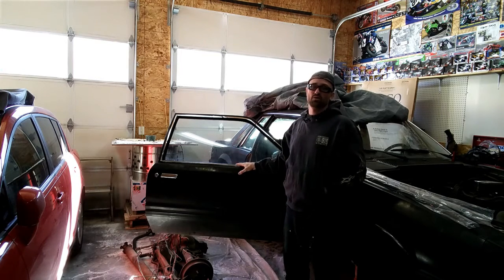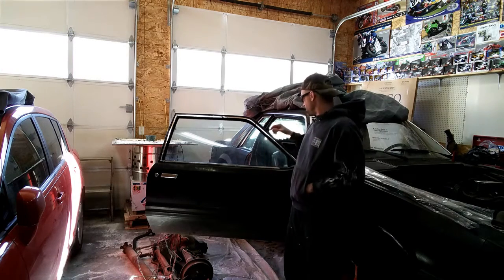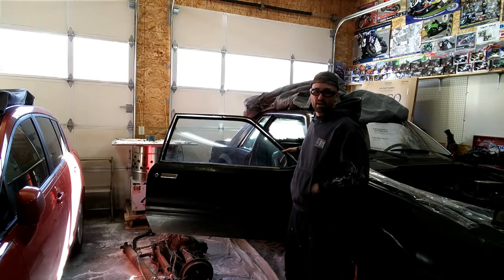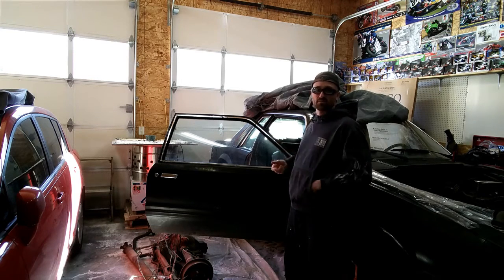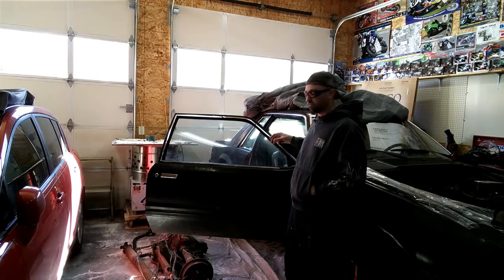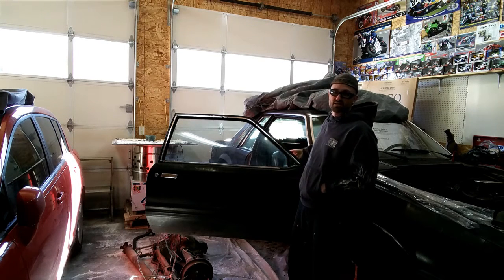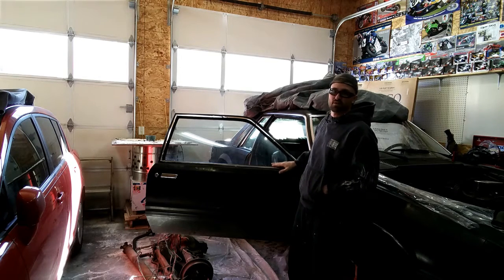I've ordered parts already and they're here. The first thing to do is take the inside corner cover off — now whether that's a screw on the aero cars or on the 4i cars, manual or that, there's a set screw in them, take that off. Then you're going to take off the mirror, that's two studs on the inside using a 9mm socket. Take those off and then you can get to this piece here.